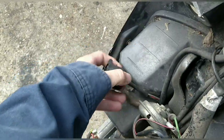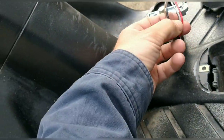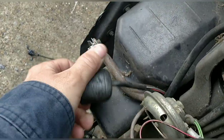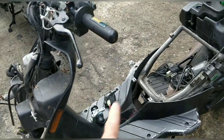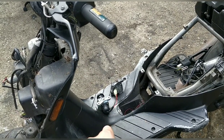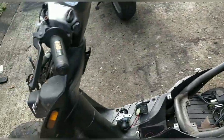We can check the wiring here — white, black, red, brown, and a separate black and white. Excellent, it's exactly the same, so this should be plug and play. Interesting because I checked everywhere and it said 50cc, said it wouldn't fit this bike, but I believe it is going to fit. I'll chuck that on in a minute.